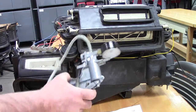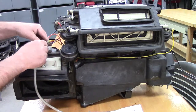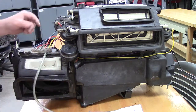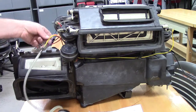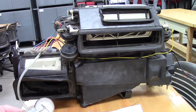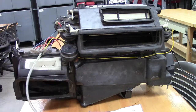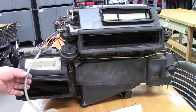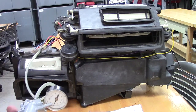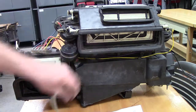If I take this handheld Mighty Vac, which I can make vacuum with, and go to one of these devices, I'm going to pick out the yellow wire. There are also diagrams you can get from manufacturer specifications. If I apply vacuum to this yellow one, we should be able to see this door, which is our bi-level, open up, and now we would have a lot of air coming out. That's usually our AC system that we love that one to be on. So a vacuum source to these vacuum servos will do that. Of course I can release the vacuum and it goes closed.